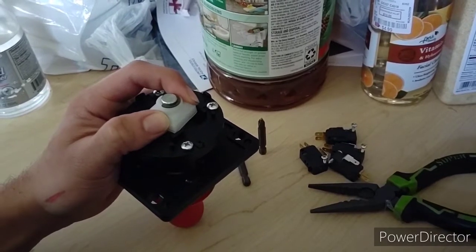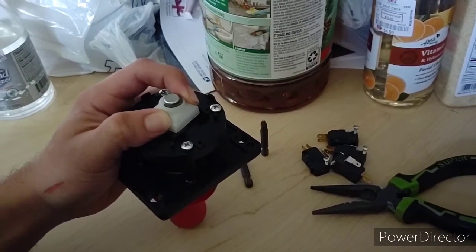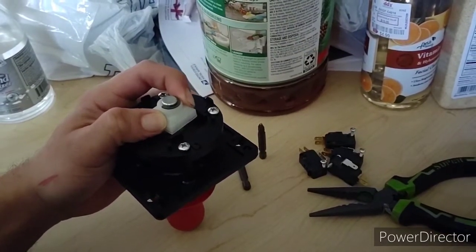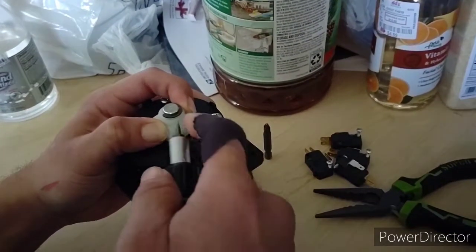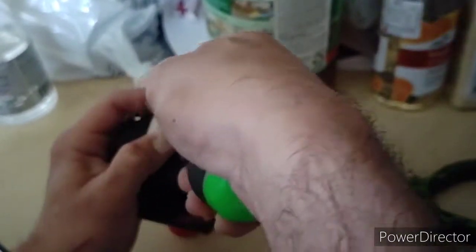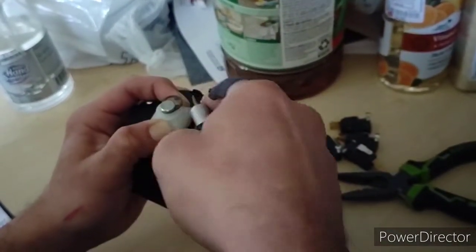First, I'm going to set the joystick down, pulling the unit down. And I don't know why I always refer to these things as units, but that's kind of funny. Then I'm going to push down on the actuator, which is being pushed up by the spring, and I wedge this in between and gently just push away. And it comes off really easily.